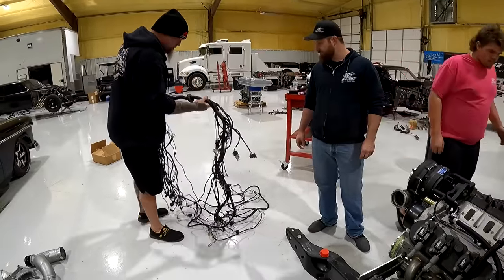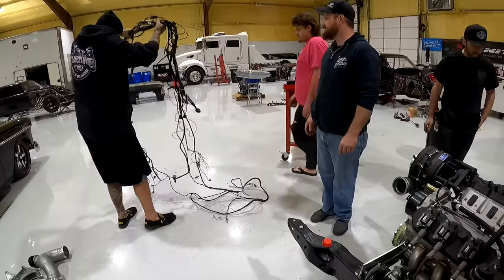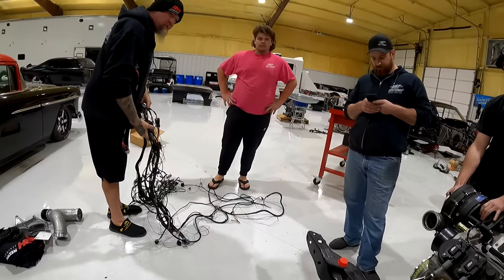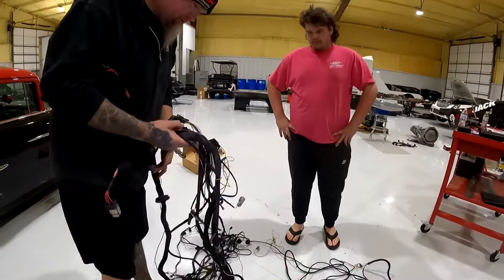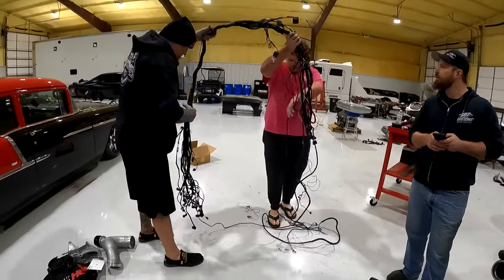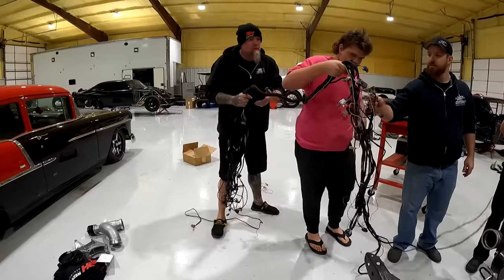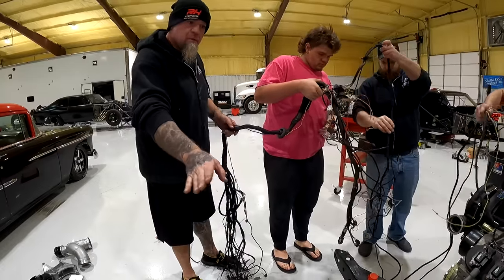We're gonna run a new TPS wire. Come here. That's the transmission wire right there. But it went through the rusted out floorboard in the 55, so we'll cut a hole underneath the console. Or we can unpin it and I can just rewire it. Here, Aiden, all of this goes through. All that. Watch that. Through that hole? Yep. Where is the... Oh, the transmission clicks in here, doesn't it? Yeah, I remember now. It would be nice if we could bring it back out, that plug, though, and just run it down the tunnel.